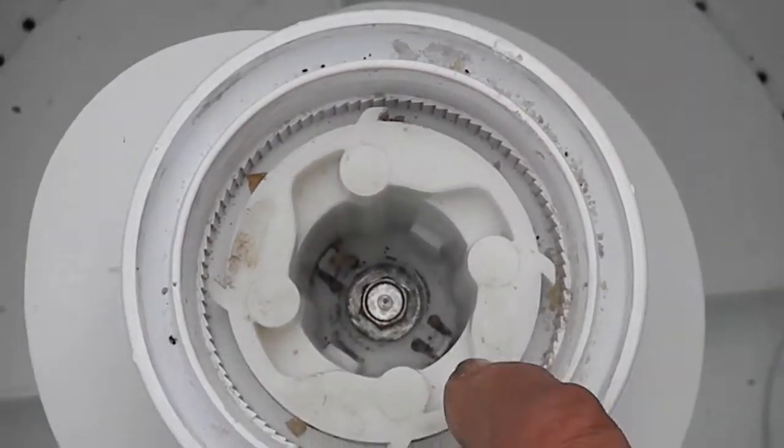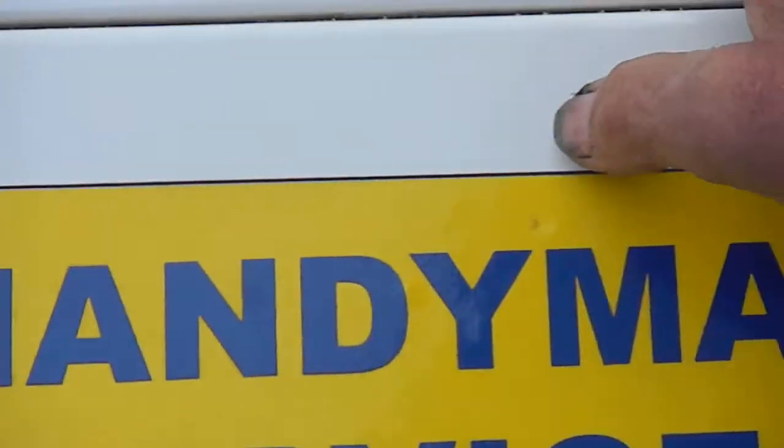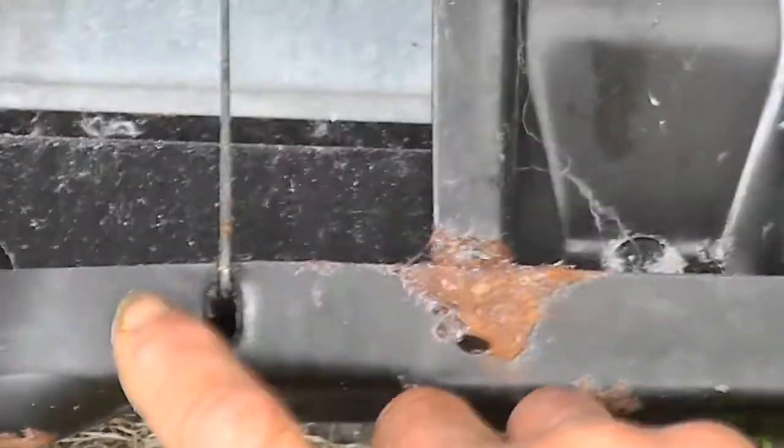So this 7/16 bolt will have to come out, the centerpiece will have to come out, and then the new dogs will go inside underneath — that would fix that problem. Looking at the bottom, this spring here will commonly give out, rust at that point, and break, causing the whole barrel to be off balance when you run a load. The slide plate can also come disengaged from between these three bolts.